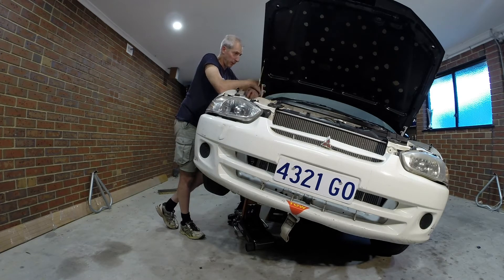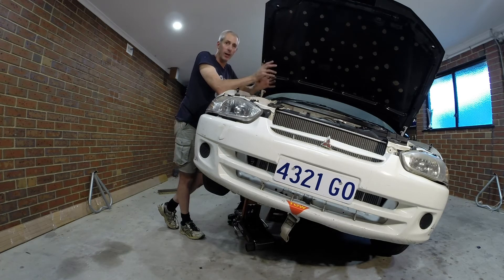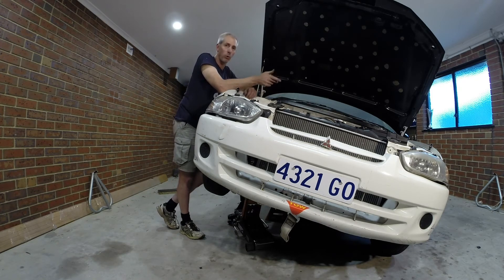I do think that this works. I was recommended this by my suspension experts - I use Pedder's for my suspension, and they recommended that I put one on the top and one on the bottom. I do know that what their recommendations suggested was true. I would never have believed that that cross member underneath would have had any flexation in it, and it certainly has. One brace from the top or the bottom will brace the car enough, and in my application I've gone both.